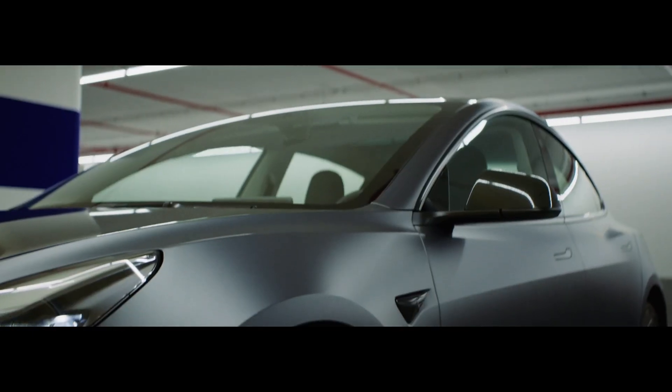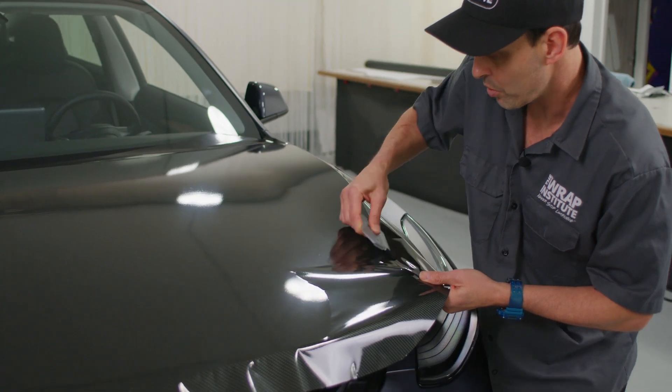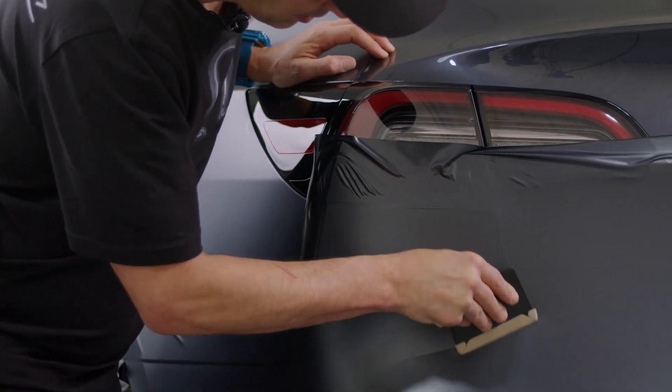So that's the only thing you have to know for the install. With Omega Skins, because you don't have the full air egress feature — only the micro repositionable — instead of using your glove a lot like with standard air egress films, the idea now is to squeegee with firm, overlapping squeegee strokes, keeping them shorter to make sure all the air goes out. If you do get bubbles, they still mostly come away, which is cool.